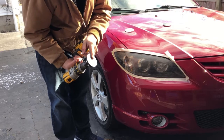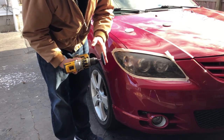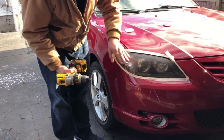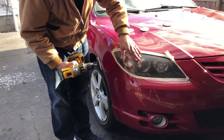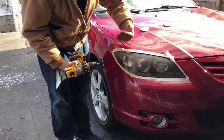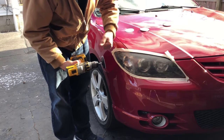Go over the lens multiple times for a couple of minutes. If your pad clogs, switch to another pad. This is the coarsest sandpaper, so it takes the most material off — put a lot of time and care into this step. That way, when you move to the finer sandpapers in the next steps, you won't have to remove as much to get the desired effect.